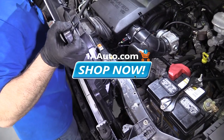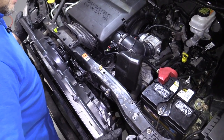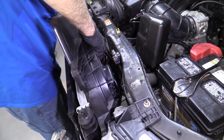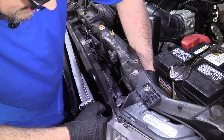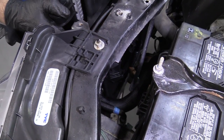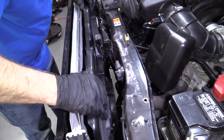Take the coolant fans and just slide this into position. Watch this lower radiator hose down here — the little one — and make sure you don't crush that. This is obviously a lot easier if you have the upper radiator hose off, but it's not impossible to get it on without taking that off.